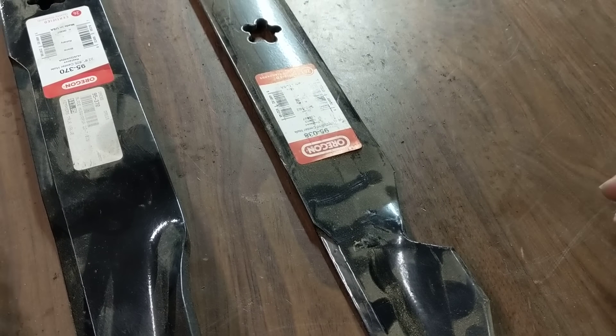You'll see that the cutting edge on this is longer all the way through — that's just an extended cut blade. This also is almost a hybrid mulching blade since that center part's a little higher, but it is a high lift blade. It is not a notch — you see that's still there, so this swoops down nice and slow, not as abrupt as some notches. Highly used blade. Depending on whether you're going to be bagging or side discharging, they work pretty good.